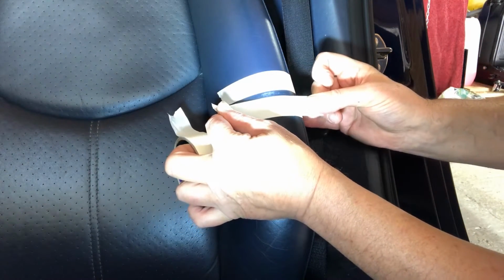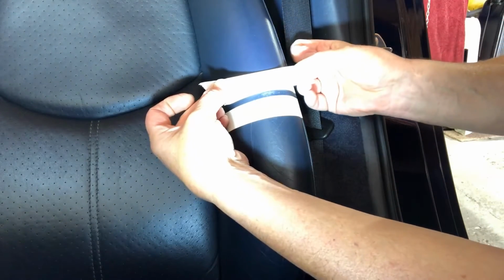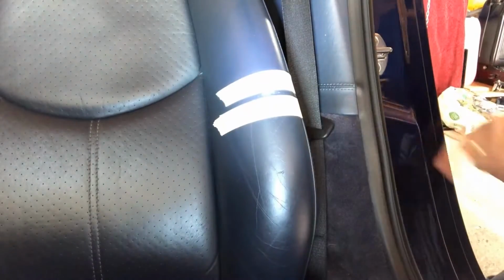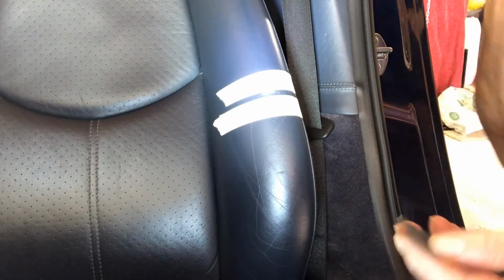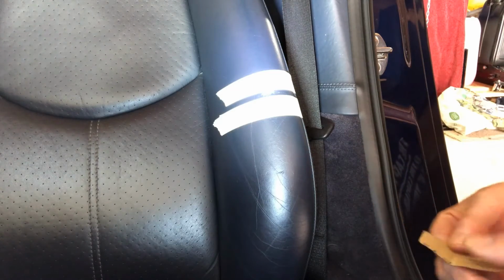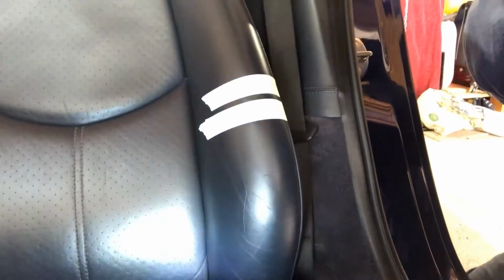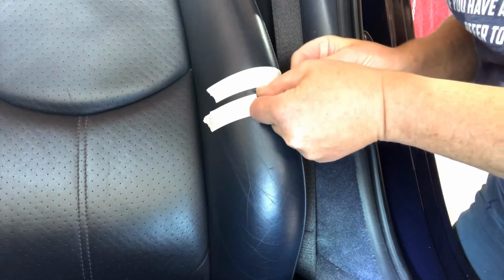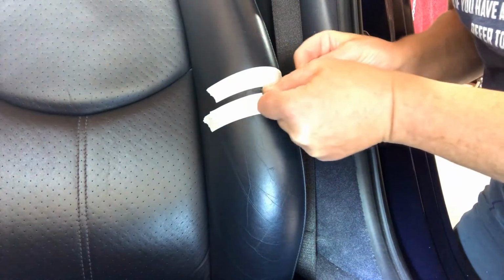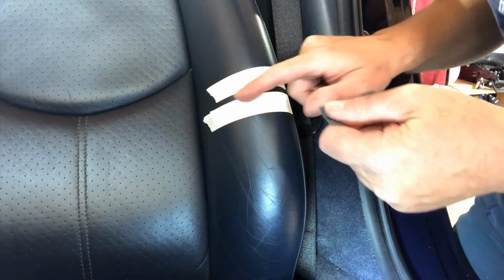And the reason I'm going to do that is because whenever you're using sandpaper on an area as fine and narrow as this, you are always going to catch it on a bigger area, and I'm intent on not doing that as much as possible. So I have a tiny piece of P1200 wet and dry, tiniest piece of sandpaper in the world, and I am going to, let me see if I can take that light away. I don't know how well you can see that, but I'm just going to literally rub that area, just to take off any burrs that might be there.